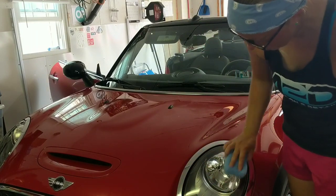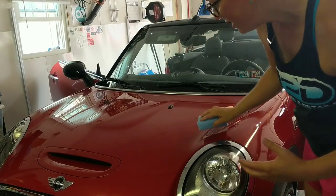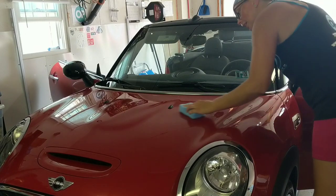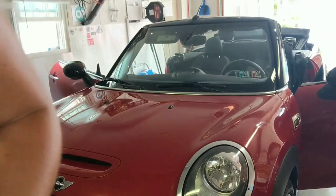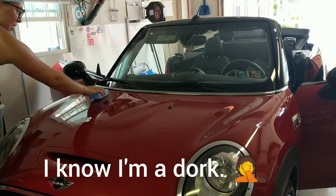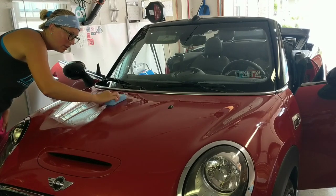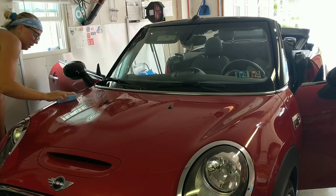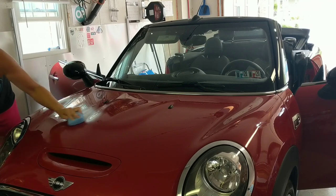Get your headlights too — that way you're putting UV protection on there. It's like 100 degrees out today. Just do your wax-on kind of technique. You don't want to wax it off at this point, so just wax on and spread it out. You don't want it to be thick — you just want to have a translucent product all over the panel. You can use this on glass, chrome, even your trim. It's not going to stain it.